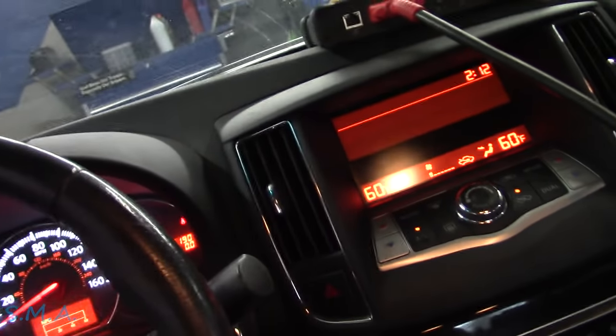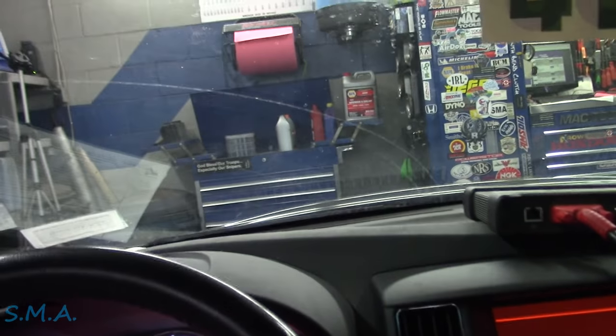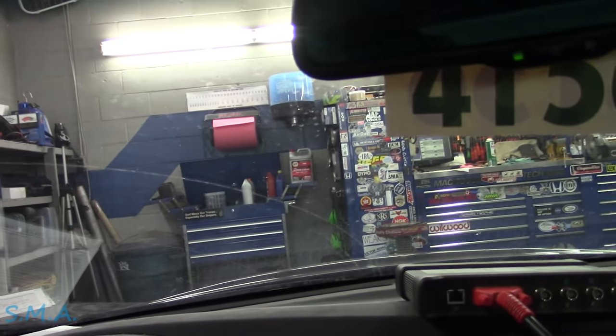I had the AC cranking because we had to recharge it — the inner components are not easy to access on these; you have to pull the AC compressor off. Also, here's the note from the Nissan dealer in Rochester. It says: ABS wheel speed sensors were replaced, a warning light flashed when turning right, the vehicle was incorrectly diagnosed, and the lead tech diagnosed an internal failure in the engine room harness requiring a full harness replacement. Customer declined. Wow.